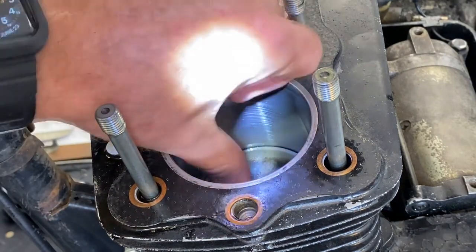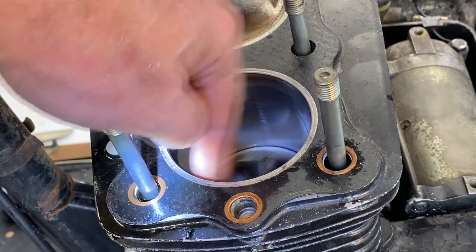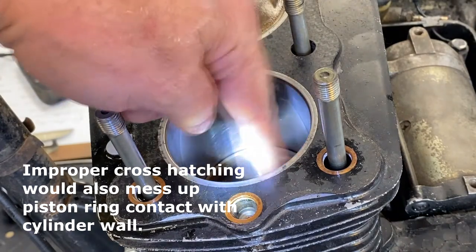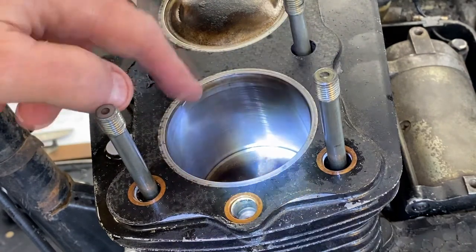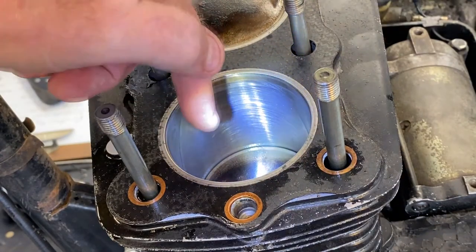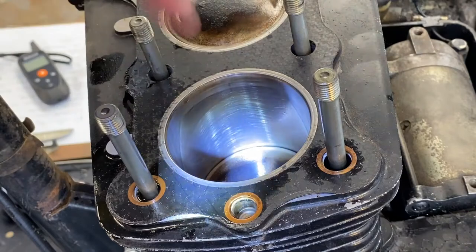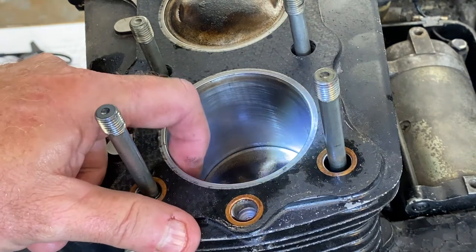What could also cause this is the honing itself, because the honing on this number one in particular is almost straight across, like circular, without hardly any angle or compound angle to it at all. If you have honing that essentially creates circular scratches, it's too much surface area on the piston rings, and therefore you're going to lose compression. That's why a professional hone is about 40, 45 or 46 degrees, where you have a slower RPM on the hone and a faster RPM on the plunge and return, and that gives you a steeper grooving, or steeper honing.